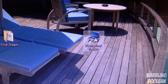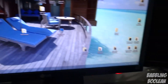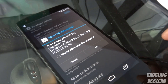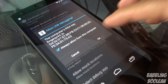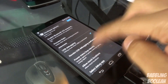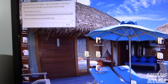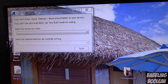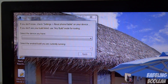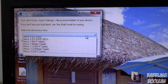Let me open up the program. I want to warn you that unlocking the bootloader will wipe everything off your device. When you open the program, your device will show a pop-up while USB debugging mode is on — check 'Always allow from this computer' and press OK. It's imperative that you let that happen; it must show up on your screen. If your screen turns off, turn it on and look for that pop-up. Anytime you open the Nexus Root Toolkit, if that doesn't work, nothing will work. So make sure you back up all your pictures, videos, and music — your apps will be erased.